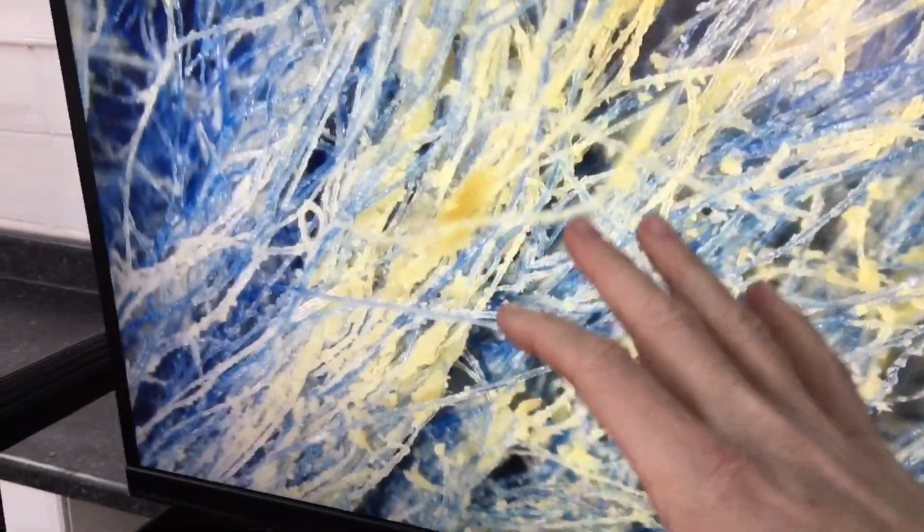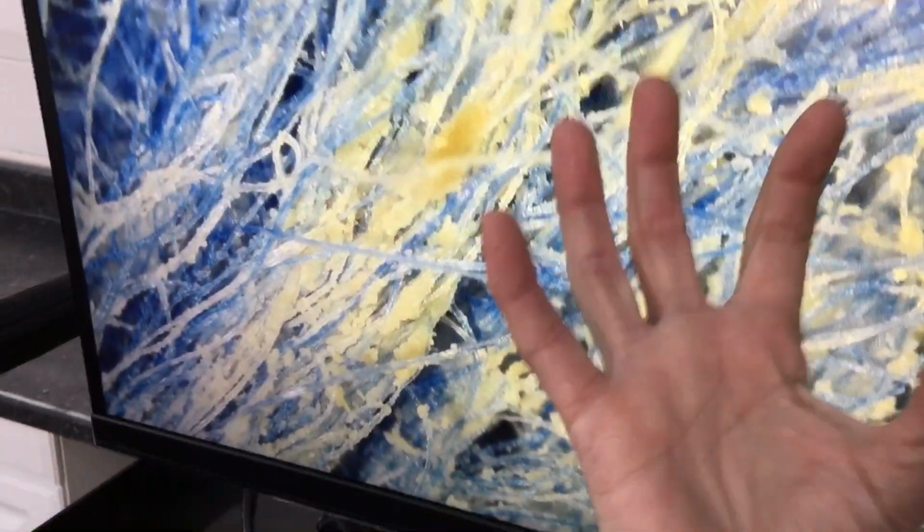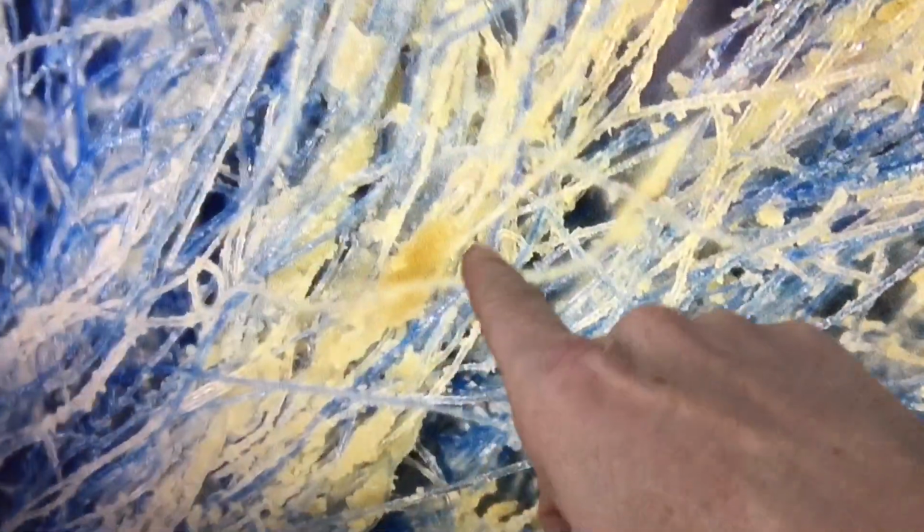Caked with polish and compounds, and you'll see the difference. Okay, now as you're using the pad and it gets more and more saturated with the compound or polish you're using, plus the clear that it's pulling off, it clumps together. It pulls the fibers together, they no longer work independently, and you lose your consistent cut. So, again guys, clean out your pads in between every pass.